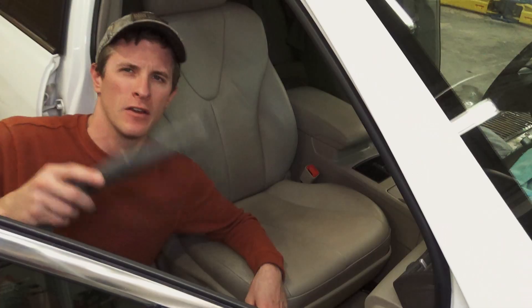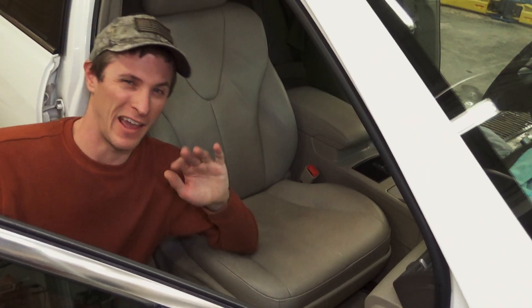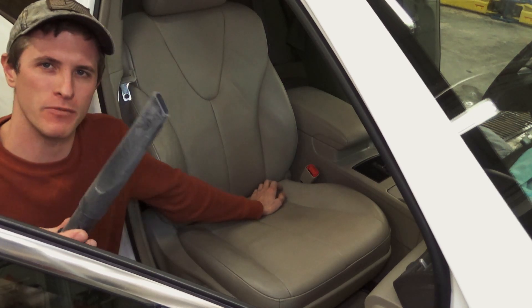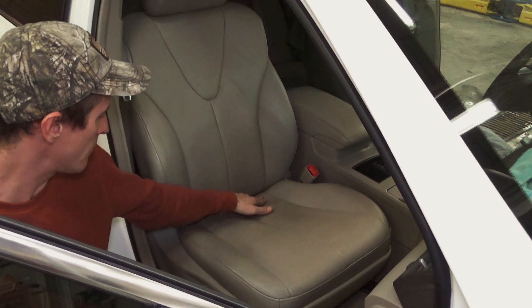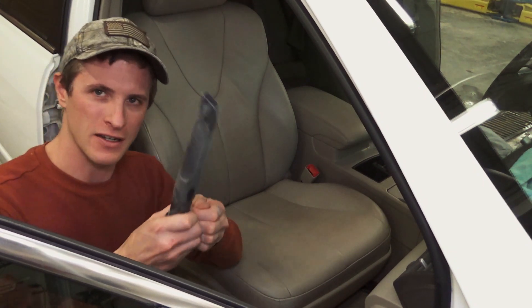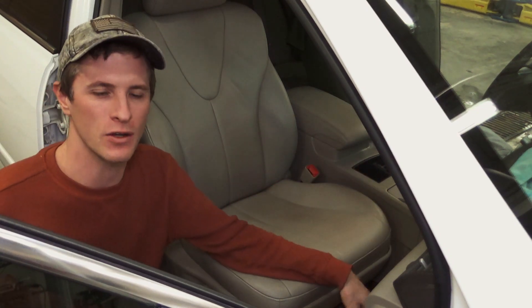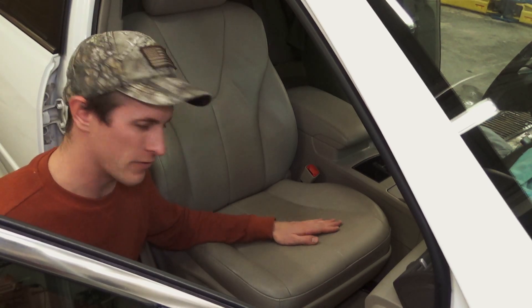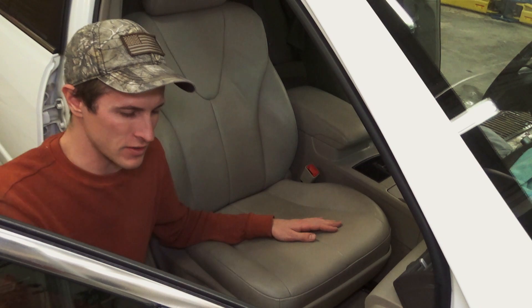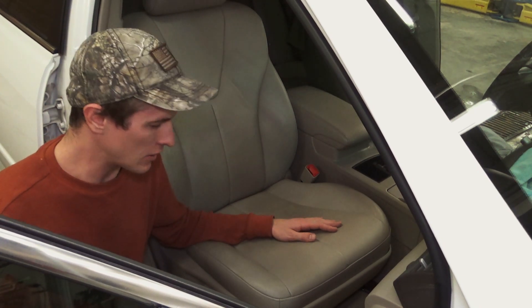Let me finish this dashboard — our next step is the vacuum. I'm going to vacuum the seats first using a standard crevice tool. I'm going to push the seams of the leather open and vacuum up, because one of the things that really rots the stitches is when sand and pocket lint gets in the seams and constantly grinds together, rotting the threads out and causing the seats to open up. I'm also going to vacuum the cup holders and all that other stuff, then we'll condition the leather.